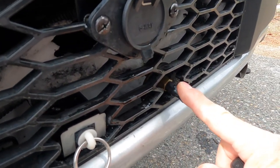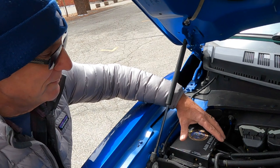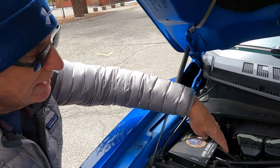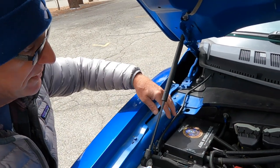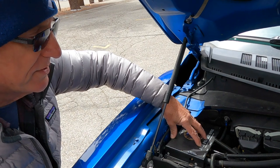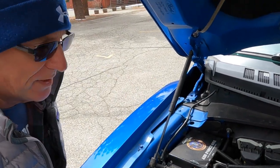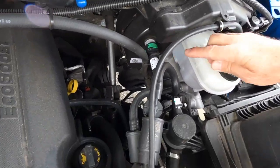This is the air supply that feeds the Air Force One braking system. This is the Air Force One braking brain, and it's not real complicated. It connects into the battery, needs a vacuum supply, and has some wiring that goes into your brake system. A lot of people choose to mount this themselves. It's pretty well marked — you've got a vacuum line, air in, air out, the electrical has to be grounded. For F-150 users, you have to be really careful because there is a special T-fitting adapter that goes right into the vacuum brake assist.